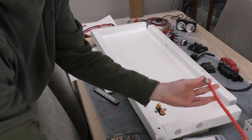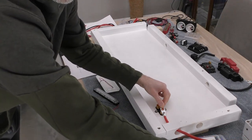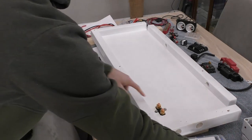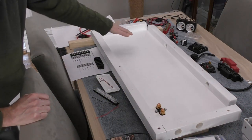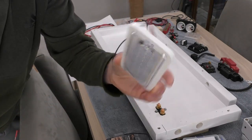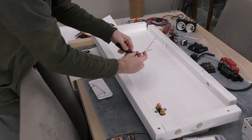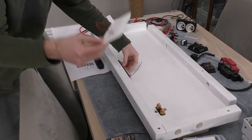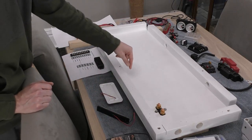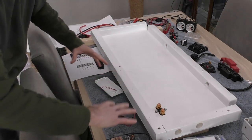What I like about this battery cutoff switch is it provides a little bit of strain relief. I've got this three-eighths cable here that I'm going to put some terminal lugs on, or I can run it right off of here — this will provide strain relief if anything knocks against the positive cable. Then I can run a second cable from here to the positive terminal block. I've also got a couple of LED lights — one thin and one fat — both 12 volts with no switches. I'm going to mount one inside here and one on the underside, with a switch run to them wired to constant power.